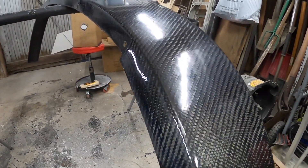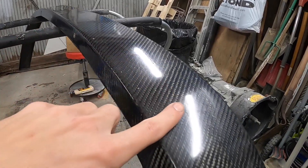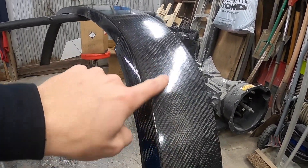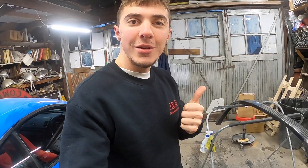What I was trying to do was avoid having to re-resin it, but we're going to have to re-resin. You can see some of the pinholes — big divots in here — which I want to get rid of. It did flatten it out, which was the goal, but I'd rather this thing look as brand new as possible than have a bunch of pinholes and be only somewhat shiny. So you are going to see me scuff this thing up and get it ready for some resin.